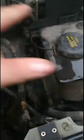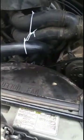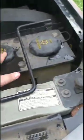Alright, so now we have filled the radiator itself and the radiator coolant reservoir with water. A little over 4 gallons, I think. We've squeezed the hose, make sure we got most of the air out, if not everything. So now I'm going to start it, let it run for a minute, make sure that it's gotten all the water down in there that it needs, and then we're going to refill this if we need to.